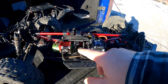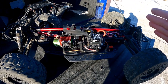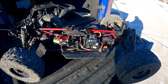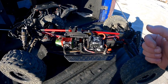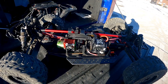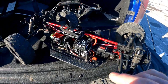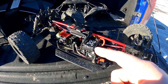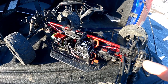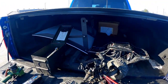I have the same motor in my Mojave geared for around 60 miles an hour and it stays cool. The less weight in these trucks the better — it's easier on impacts, landings, crashes, less wear and tear, less pressure on the batteries. There's a lot of benefits to running something that's just right for the car. This is going to be the first test with this setup. I'm running the same pinion as I was with the Spektrum 2050, so it's a 14-tooth. We're going to do a speed run to compare between the stock setup and this setup.